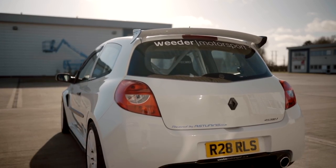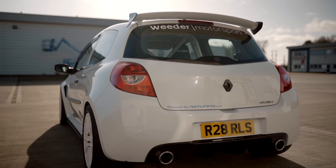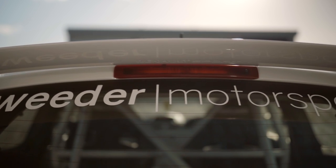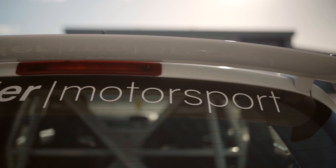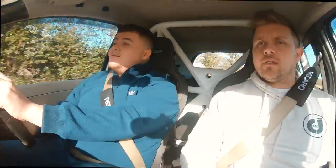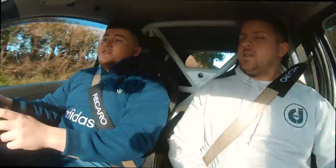I've had the conversion done near on three years. It's been reliable then? I wouldn't go that far — I've had issues. What's kind of gone wrong since you've had the Megane engine in? I had an issue with the car completely immobilising itself. It turns out there wasn't really much wrong — it's just French. There was a wiring issue. The passenger-side front wheel arch liner had been split, and when I was washing the car, water was getting in. There's a fuse box that sits just above the wheel arch and it was soaked. When it was wet, it shorted and completely immobilised the car.